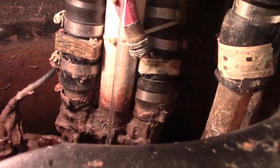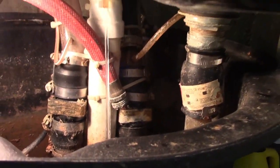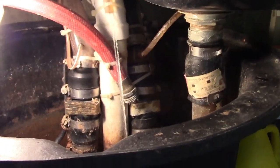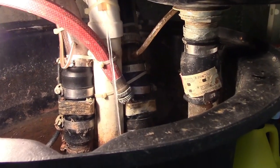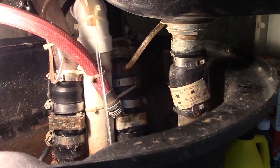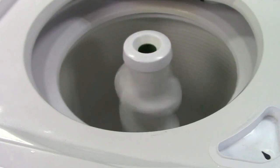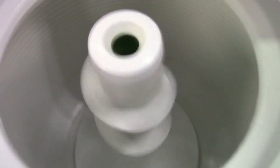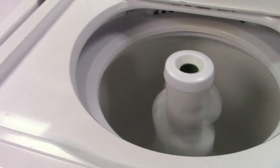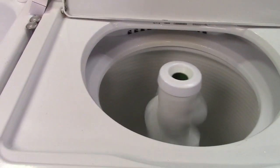Do you hear all that churning? That strong stream is not really normal — it should theoretically bypass that for the most part as was originally set up. But over time I've been noticing this, and eventually the washer finished draining out through the spin. The washer is now devoid of water and working fine. And this normally wouldn't pose an issue, except that it's draining slowly. That would tend to indicate that the drain is somehow occluded — that's a fancy term that means blocked.